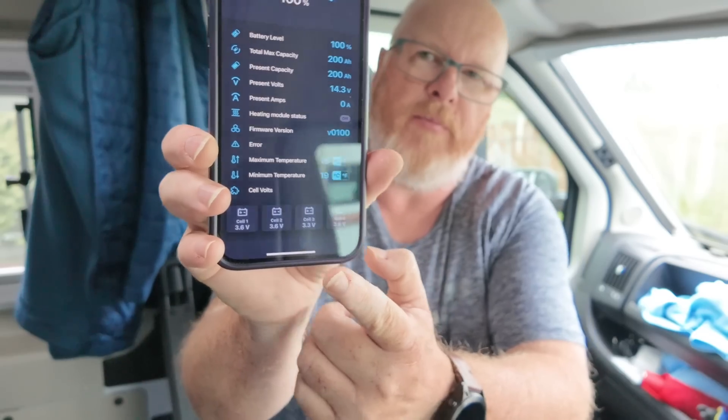At the bottom there you'll see battery cell voltages. My 12 volt single lithium battery has little tiny batteries in them, made up into cells to increase their capacity. There are lots of parallel cells connected in series to make up 12 volts. However, each cell shown here is 3.6 volts — and 3.6 volts doesn't equal 12 volts. So 3.6 times 4 is 14.4, which we all recognize as around about the charging voltage — 14.4 to 14.6 — of a lithium battery.